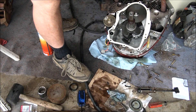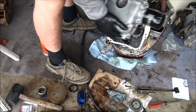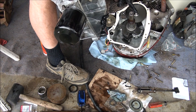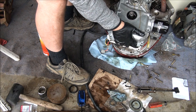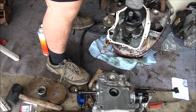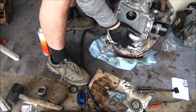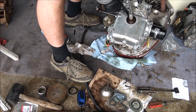Gently put the cover on, and keep in mind you have to line up the camshaft to get it into that hole there. Don't want to force anything at this point. It's starting to rain out here pretty good. Okay, it's starting to slide into place — let's see where it's getting hung up. I want to try and ease it in there so I don't damage the seal when I put it back together.